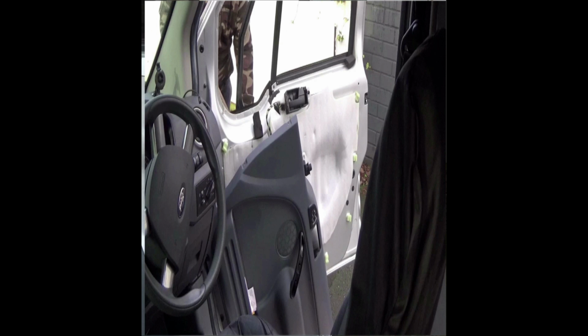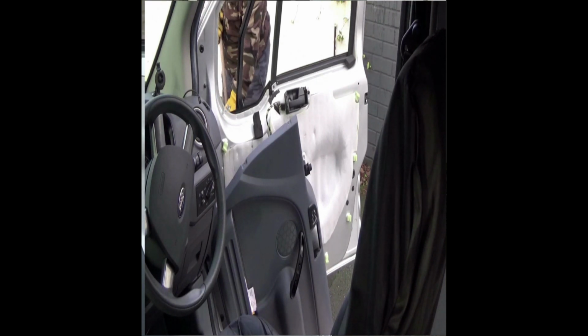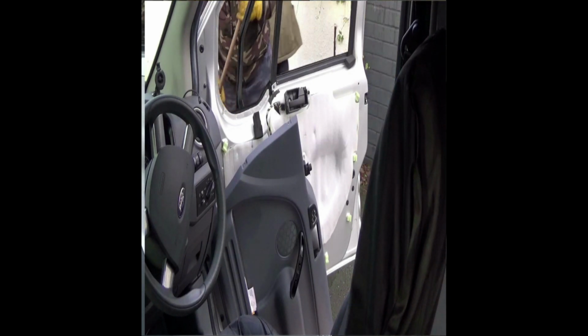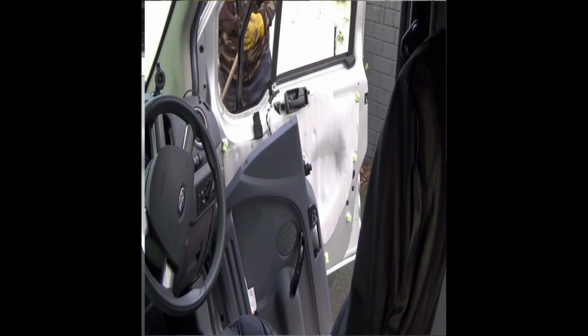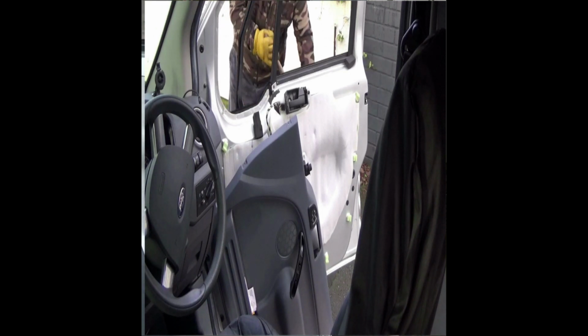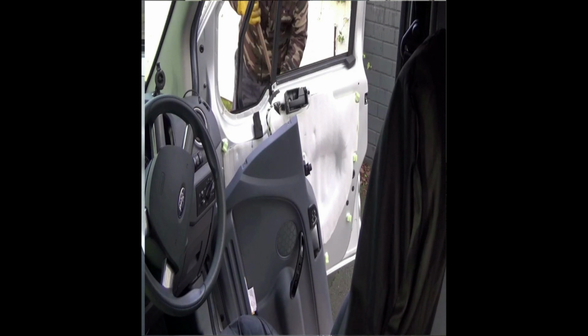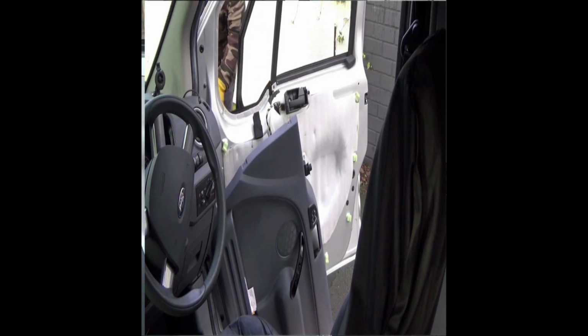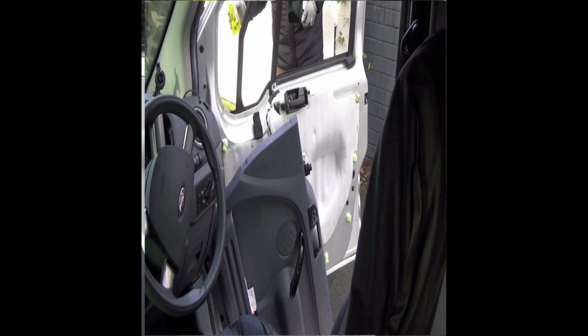The big key to this is to get some washing up liquid. Use plenty of washing up liquid to lubricate the rubber and the glass going back in. This will make your life 10 times easier. Be pretty generous with the washing up liquid, but keep a rag with you so you can wipe the excess off, because the idea is it makes the rubber slippy, and in making the rubber slippy, it's going to make your hands slippy. So make sure you've got a couple of tea towels to keep your hands dry, so you can grip the glass and the rubber, and the rubber will slide into the frame itself. That should go in quite easily. Obviously you've got to put a bit of umpty behind it.